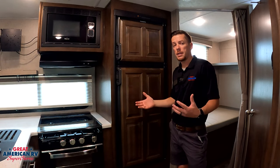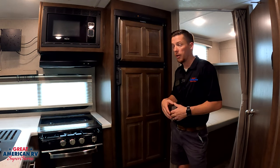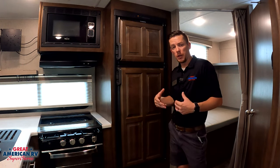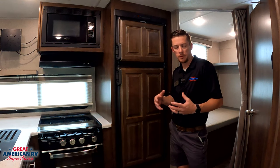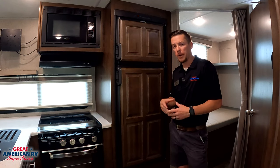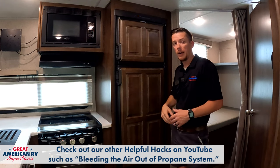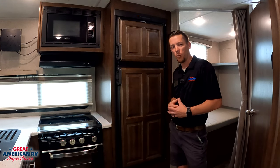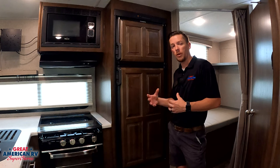Now let's talk about if it's not operating off gas — whether it's on auto and you unplugged from shore power and you're still getting a check light, or if you just chose gas-only and you're getting a check light. Oftentimes customers pull their units out of storage with LP tanks turned off. When you turn them on, there's air in the lines. The first thing you want to do is go over to your stove, turn it on, light it, let it run for a bit, make sure you have a nice blue flame, then cut it off and go back and restart your fridge to see if that fixes the problem. We'll step outside so you can listen for the igniter trying to ignite — that'll help you know whether you have air in the lines or another issue.